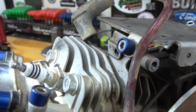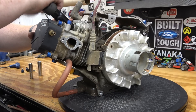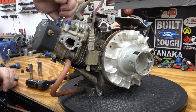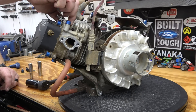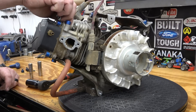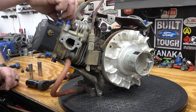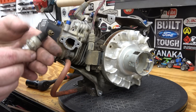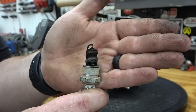This thing's three to four years old and still has the original iridium spark plug. For some reason I was running a spark plug spacer — just doesn't make any sense, maybe I was an idiot back then. This head I don't think has been milled any, it could be milled a little bit — 20, 30 thousandths — but I don't remember. She was running a little rich.